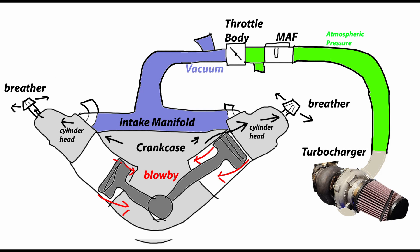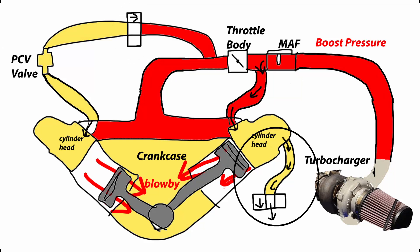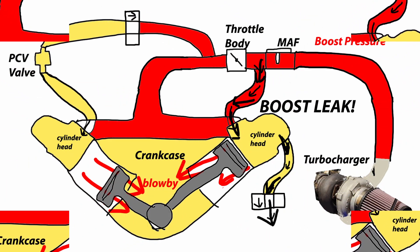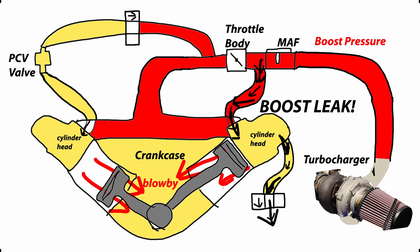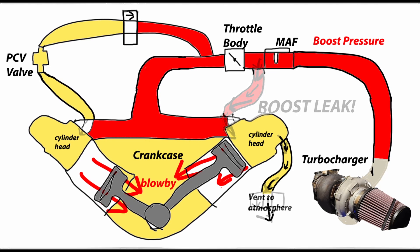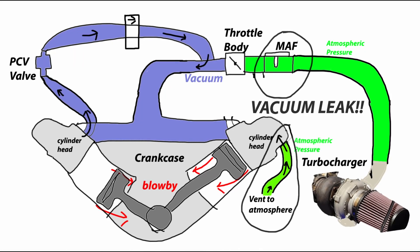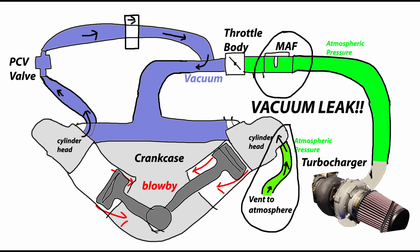The risk I see with this is that you build up a lot of moisture inside the crankcase that's hard to evacuate unless you're really driving the car quite a bit and getting the oil up to operating temperature to burn off that moisture. The quick and dirty solution might be to add check valves by the PCV system and also another breather so you have an outlet for all that crankcase pressure. This would allow the PCV system to work properly under vacuum conditions but not under boost, and gives you that outlet for crankcase pressure. However that creates a boost leak when you're under boost conditions — you have extra metered air flowing out of the valve cover. If you get rid of the pathway behind the mass airflow sensor and vent to atmosphere, you solve the boost leak but now you've created a vacuum leak because air is going through the crankcase back to the intake without being metered by the MAF.